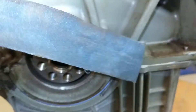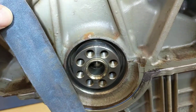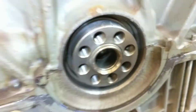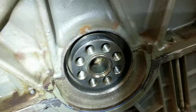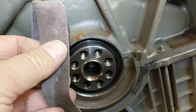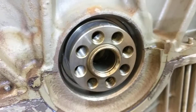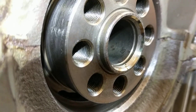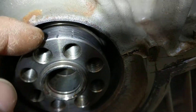I've already gone over it with emery cloth. I used 120 grit aluminum oxide emery cloth and ran it across the end of the crank two or three times, then cleaned it with brake cleaner and paper towel, repeated that two or three times. Then I used 240 grit emery cloth two or three times, wiped it out again with brake cleaner, and finally blew it out with shop air. This is the result.